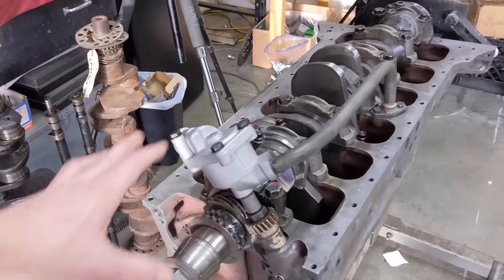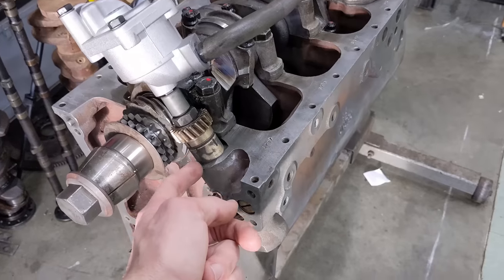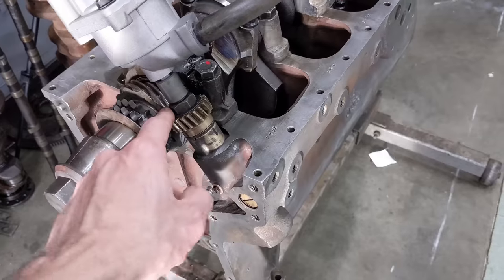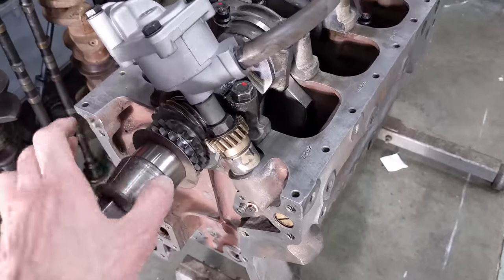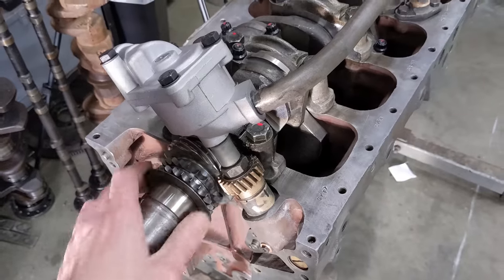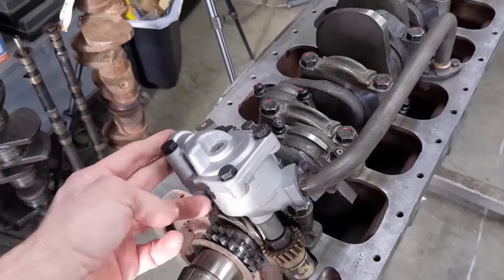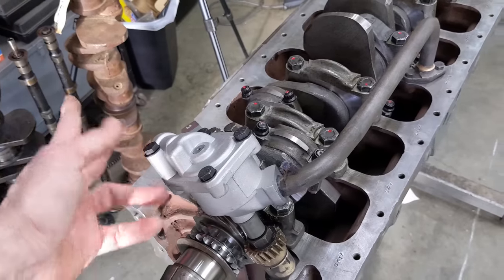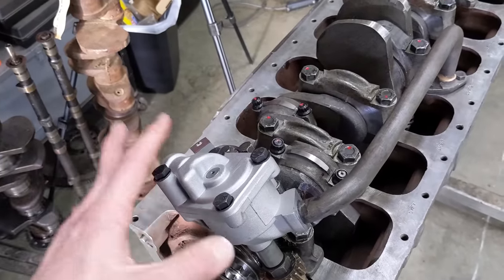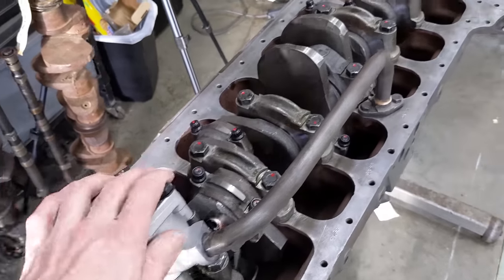Making lots of progress. You can see the oil pump up top — it's driven in tandem with the distributor drive and I had to make sure that was clocked correctly so the distributor rotor will be in the right spot. New distance tube for the oil seal, new sprocket for the timing chain. This oil pump caught me off guard — it's a later type and the pickup tube is a bigger diameter, so I need to sleeve our existing pickup tube to fit this better oil pump.